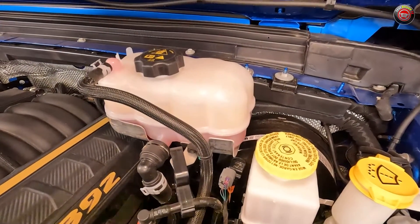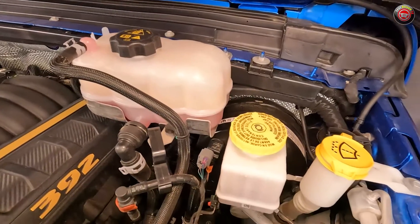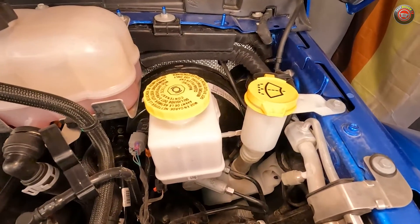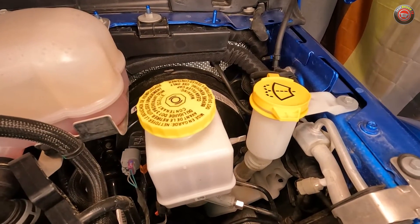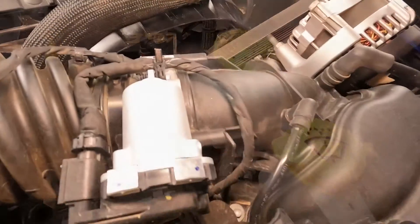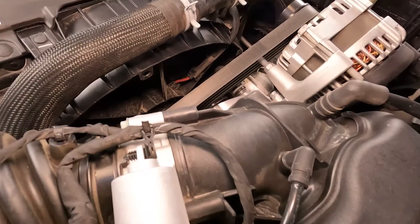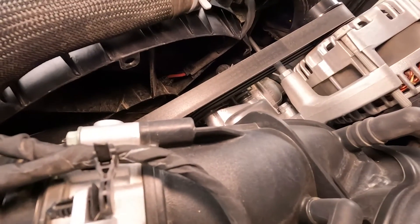On the driver's side near the firewall, you'll find grouped together the main engine coolant reservoir, the brake fluid reservoir, and to its right, the windshield washer fluid tank. Notably, this Wrangler still uses a conventional brake fluid master cylinder and brake booster, though a modern ABS control unit can be found ahead. Lastly, the main engine cooling fan can be seen looking forward towards the rear of the radiator — always be cautious, as it can start running any time, even if the engine has been turned off after it's been warmed.